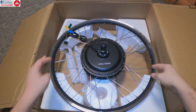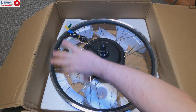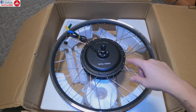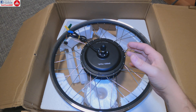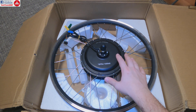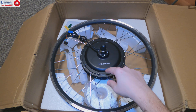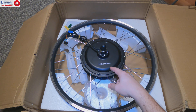This is a hub motor with no internal gears — the motor is here and this is the shaft, so everything spins. There's another type sold by this company: a geared motor with internal reduction planetary gears, like an automatic gearbox from cars, with a fixed gear ratio of around 4.5 to 1. That means at the same consumed power, the internal motor spins 4.5 times faster and produces about 4.5 times more torque when accelerating. However, geared motors are very noisy and not very fast, while hub motors are almost silent.